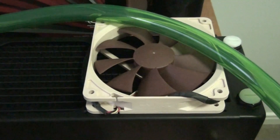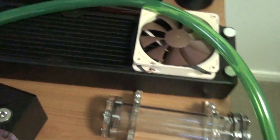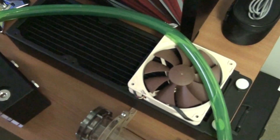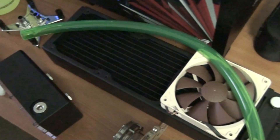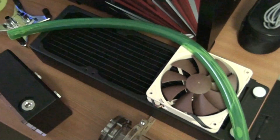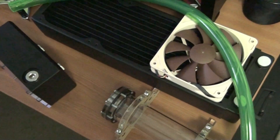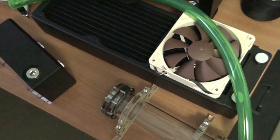Next, your fans — this is really up to the user, there are a lot of nice fans with LEDs and everything. If you go for a silent system, which I think is a very important reason to get water cooling in the first place — for silence, as well as the extra cooling and performance — you need a fan that's at least 40 CFM, maybe 35 CFM absolute bare minimum. CFM is one of the important things to look at, along with the size (120mm), the RPM, and the decibels. Anything under 20 decibels is almost inaudible; over 20 decibels you'll start to hear it.